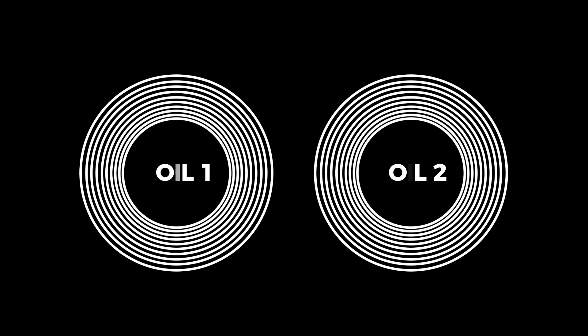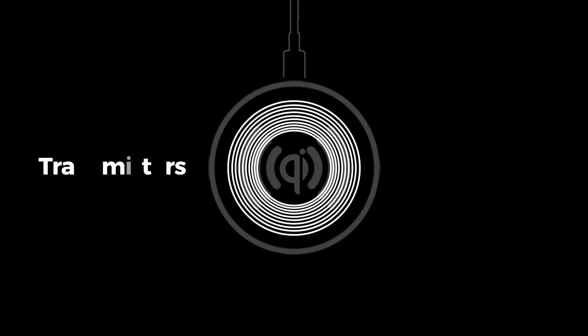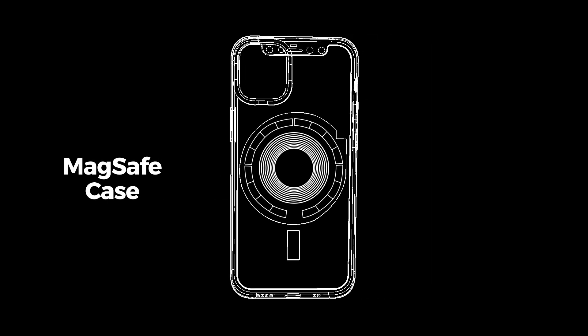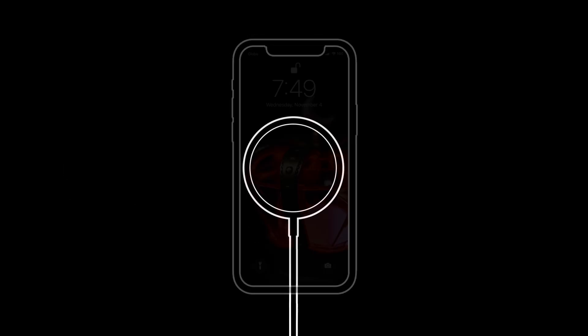Before we get to your questions, let's first take a look at how wireless charging works. In very basic terms, two electromagnetic coils — one of them connected to a power source — come together and create a magnetic field through which power is wirelessly transmitted. It's a process called electromagnetic induction. Wireless chargers have one of those electromagnetic coils as transmitters, while all phones that support wireless charging also have built-in coils as receivers. All these iPhones have a charging coil inside. But new on the iPhone 12 series is a system of magnets and other parts that enable this new feature called MagSafe.